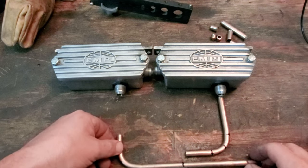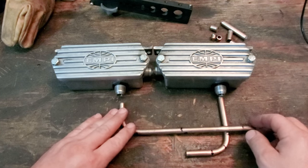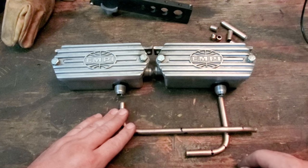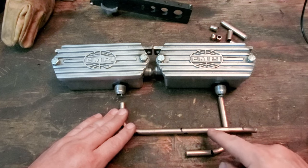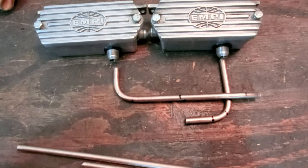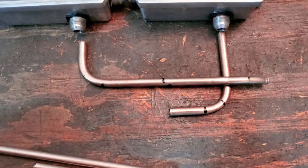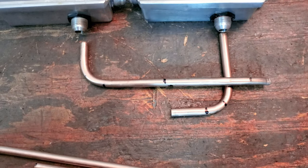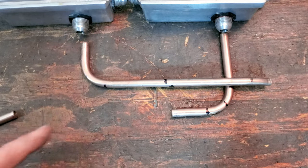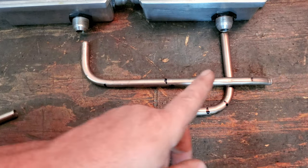So that's where you need your bend to be. You bring this pipe in, your pipe that you're bending, and you'll know that I need to mark this pipe right here, and this is the zero position. That's, zooming you guys in. That's what you need to know to be able to have a bend that makes sense to where it needs to be. All right, so you'll mark that with a marker.